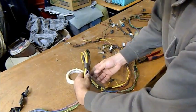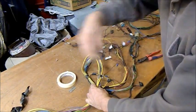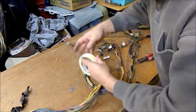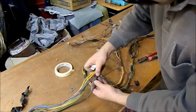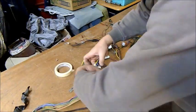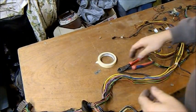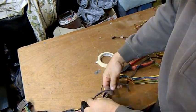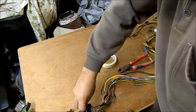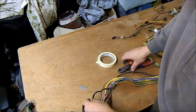I'll just wrap the loom again there, just so I know precisely where the exit point was. Because sometimes when you're threading these looms, they can be a little bit unruly because you've taken all their stability out by removing the tape. So let's get a bit of this. Less than ideal, but at the end of the day it doesn't matter that much. And I can just put that around, and therefore I know precisely where that exits, if you know what I mean. And by doing that and excluding that resistor wire, we can see that resistor wire is just sort of joined on the inside here. This looks pretty manky, this grommet. It's got like a sealing lag all over it, so I'll have to muck around with that to tidy it up. But now I know precisely where it is, I can cut that.